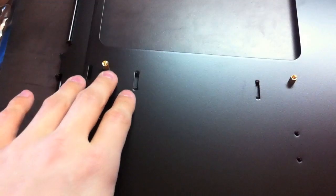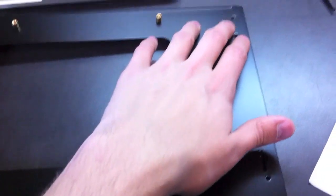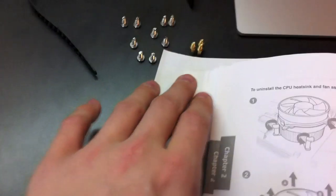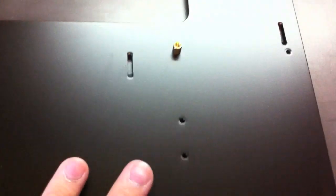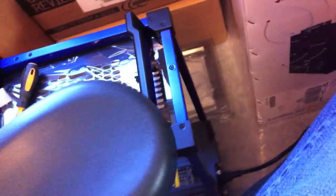The motherboard tray actually slides out of my machine, so I've taken it out here. One thing I noticed is they've only put in a couple of the motherboard standoffs. I've got to put in the other three that came included with my pack of screws that came with the case, so that they line up with the holes on the board. I'm going to go ahead and screw the standoffs into the frame, put the motherboard on, and then using the motherboard screws I'll screw the motherboard down to the case and slide this back in.